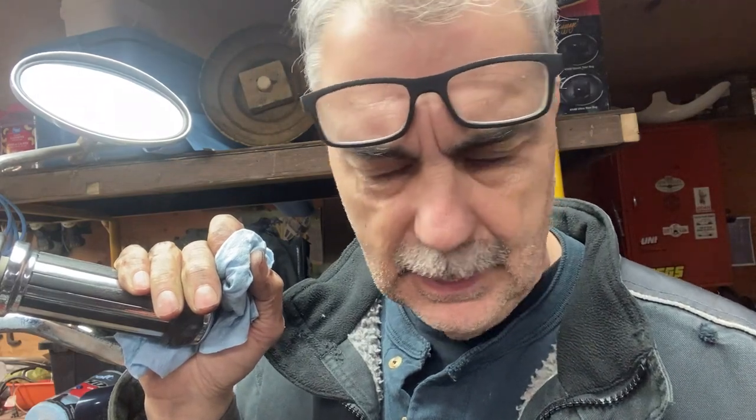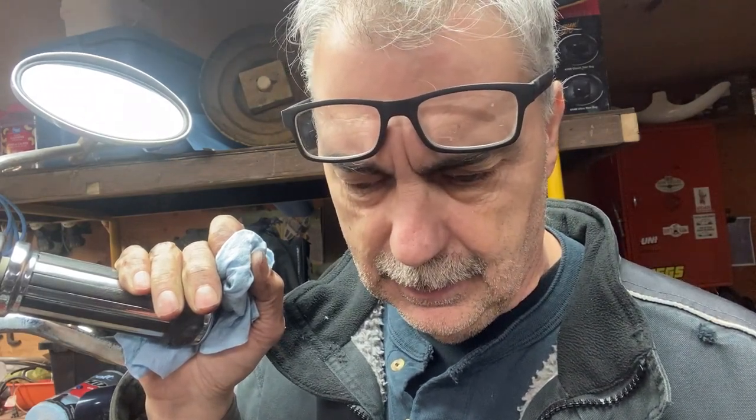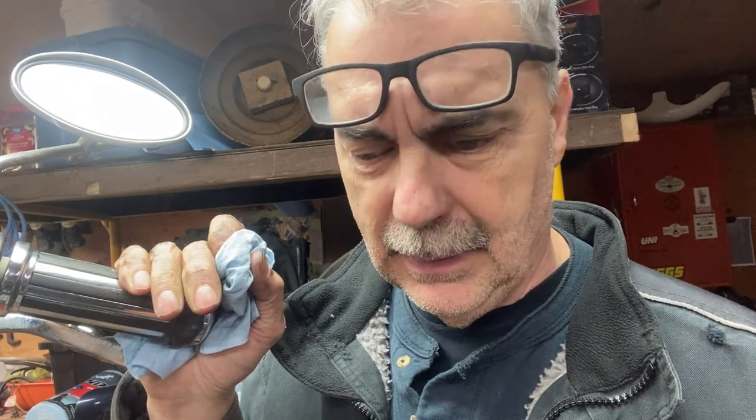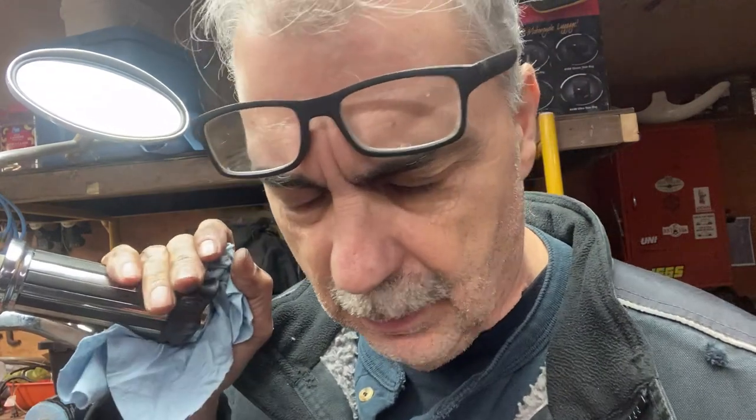It needs tires. But if I pull this head off, I've got to look at the rings. I'm going to pull the cylinders off, put a new base gasket on, look at the pistons, maybe the rings are stuck too. No compression on number three, and it's got to be leaking around the valve seats. I had 150 and 145 in number one cylinder when I first cranked this thing over dry. Putting more oil and stuff into it has just made it worse. So I'm sure they're gummed up.